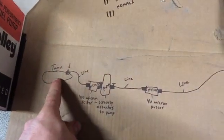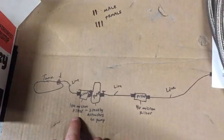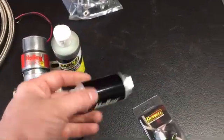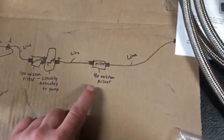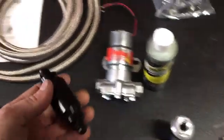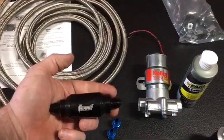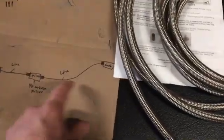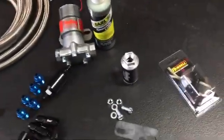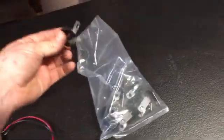I'm going to come out of the tank, and the pump recommends a 100 micron filter screwed directly to the pump - so I have a little Holley 100 micron billet fuel filter for that. Then there's the pump, and then I'm going to run a 40 micron post filter - just a little Summit 40 micron filter - and then go straight up to the carburetor. I'm not going to run a return; I don't think I'll need to. I've got cushion clamps to hold the braided line on the frame.